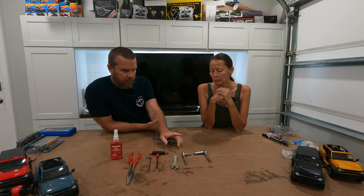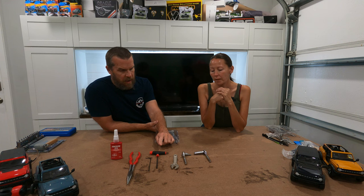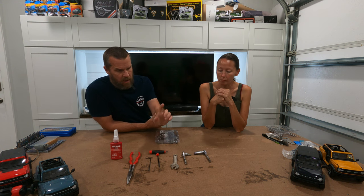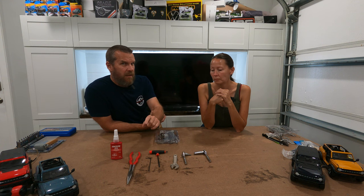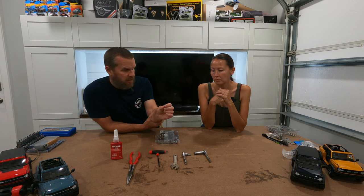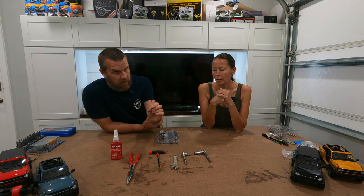What you're going to need is a 10 millimeter socket, a T30 Torx Plus bit, a 4 millimeter Allen wrench, an adjustable wrench — a small adjustable wrench would be perfect — and a pair of needle nose pliers makes it easy. It's not necessary, but you do have to put on some clips. Also a small Allen wrench that fits in a slot to hold the turnbuckle from moving while you tighten up the bolts or nuts on either side.